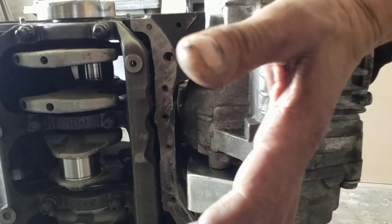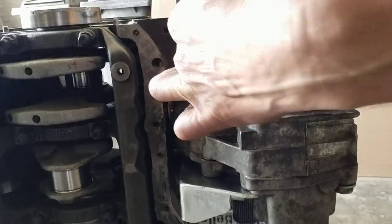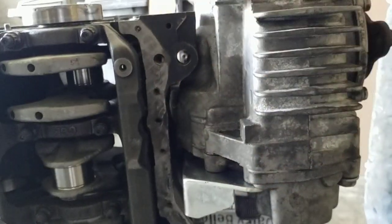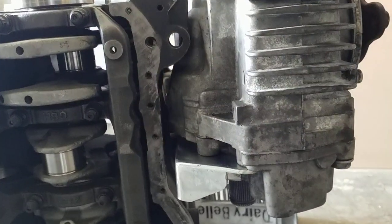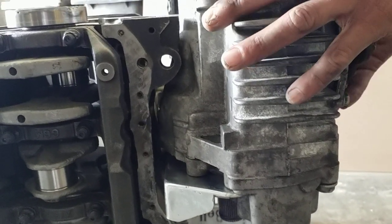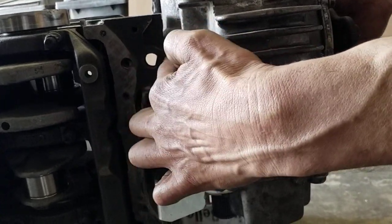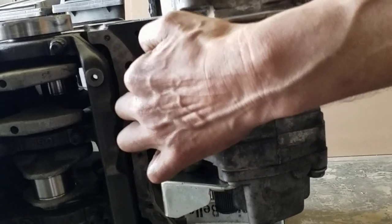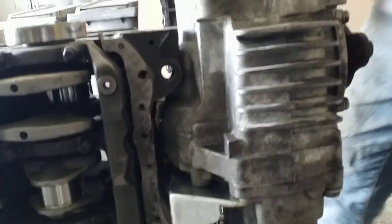Push the transfer box to the maximum, then take a one millimeter piece of plastic or cardboard, slide it behind there, and make sure there's nothing touching — that's very, very important. You don't want anything touching. You can rather have a two or three millimeter excess gap between the transfer case and the block. But behind this ear over here, don't take too much material off, because this ear now becomes a mounting hole as well.